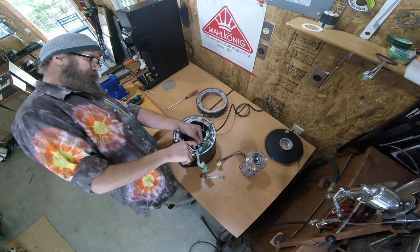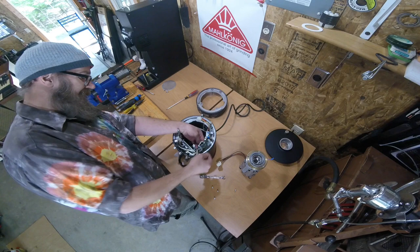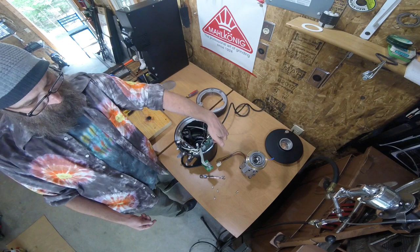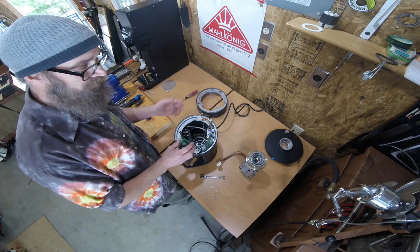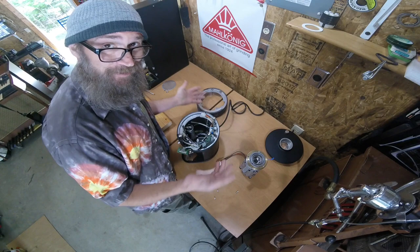There's a power board, and on the K30 Air it comes off the main power board and plugs into the fan control board. The fan control board is then plugged into the processor board, which is plugged into the display. Going back down the other end of that line it's plugged into the motor. All these are communicating with each other — there's a back and forth depending on what you're asking the grinder to do. You also have a two-position on/off switch and an over-limit.